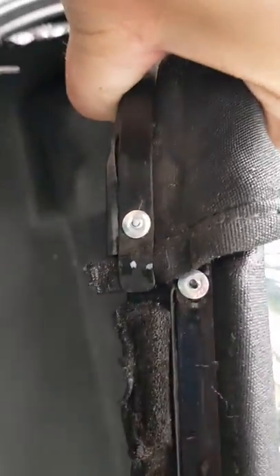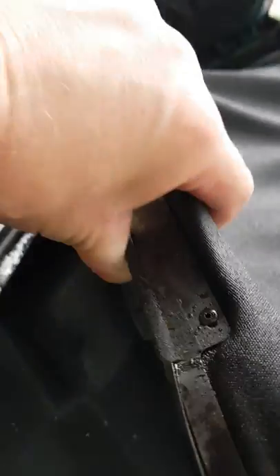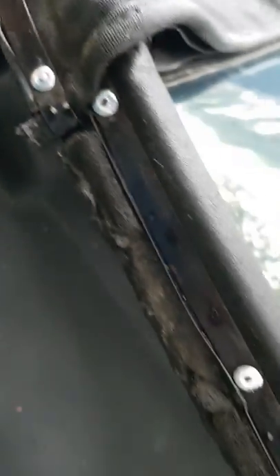That's about all you need to do inside. Get yourself outside and you'll see a line of pop rivets. Simply drill through each one. There are two hidden ones, one at each end, underneath the main roof canopy. When you take out the rivet at each end, you'll see another one down the bottom holding the end of the bar on — that's just a metal strip. Take all those out, including the two hidden ones at either end.